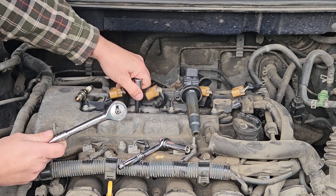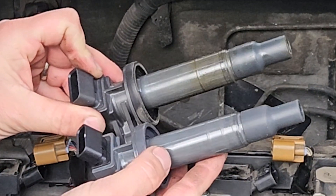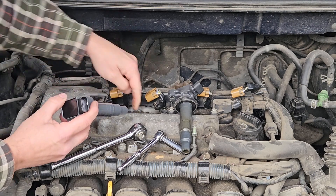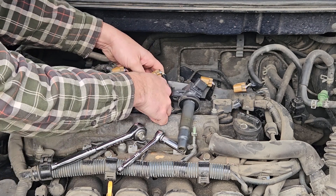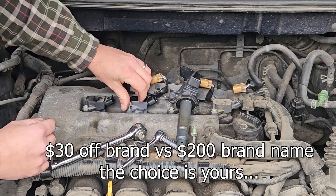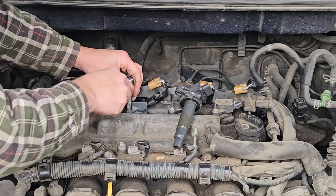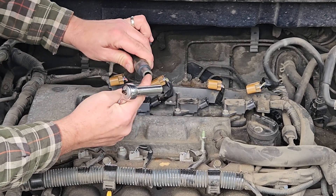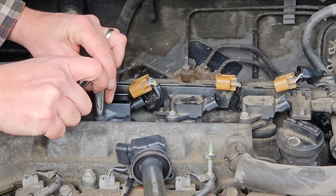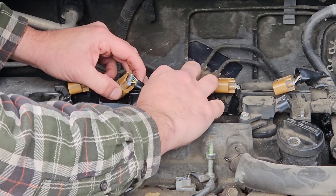So that, according to my OBD2 reader, is the culprit. Here's my new ignition coil — it sure looks a lot like the old ones. Length is right. You can get the ignition coil for these vehicles anywhere between $30 and $200 each depending on what brand name you go with. Make sure it has a nice snug fit where the spark plug meets that nice little rubber boot — there's a small spring inside. Just snug and a little twist, doesn't need to go too hard.